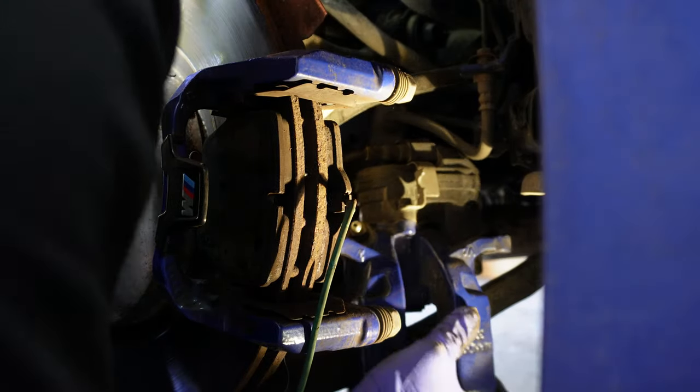Talking about the brake pad wear sensor, I know some people just like to yank it off from the pad connection over there. I like to keep it intact for that side and just undo the connection at the weatherproof box over there, so that I can reference back its orientation when I'm putting it in.